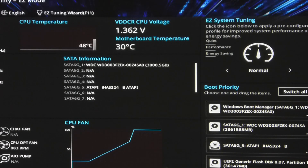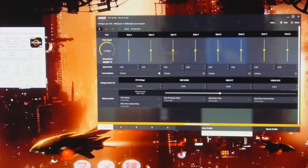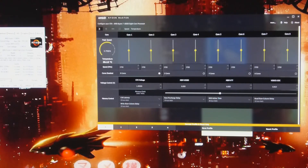And we're running at stock speeds. Let's just save and exit. I'll leave it stock for a few seconds. I've left it completely stock after updating to BIOS 0902. According to CPU-Z, even though we're only at a peak of 3.7 GHz, the temps are quite low. Voltage is jumping all around — it's going from 1.47 to 1.48, which is quite high.